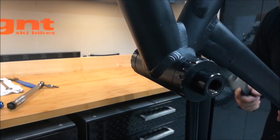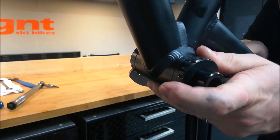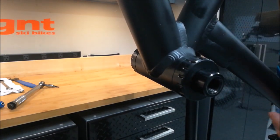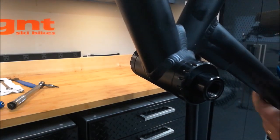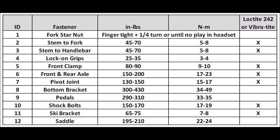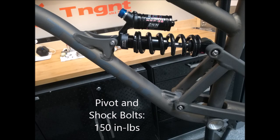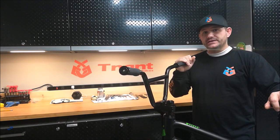The last thing you need to do before you go out riding is to tighten up the bottom bracket. The right hand cup is left hand threaded, so tighten it opposite of what you normally would. The left hand cup is right hand threaded, so go ahead and give it a good tighten. Finish up the bike by putting on the pedals, align the handlebars, and torque everything to the proper specification in the owner's manual. For the Carve, tighten the shock bolts and pivot bolts to 150 inch pounds. That completes the assembly of the Tangent Drift and Carve ski bikes. Consider waxing your skis and go ride.